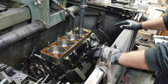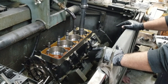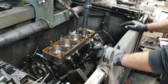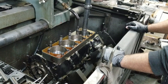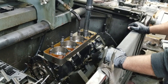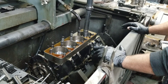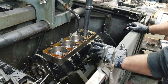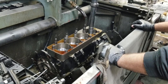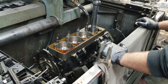I went ahead and set up the mic. Originally this thing was 4.065 to close to 4.068, somewhere in there. I set the mic up first at 4.070 and used that as the barometer — to see if we can come clean as well as keep round. That basically gave us certain cylinders 2 thousandths to work with, certain cylinders 3 thousandths, 3,500. It somewhat came clean at 4.070, but I wasn't too comfortable because I didn't have my finished stones in there yet and we were sitting right on 4.070.